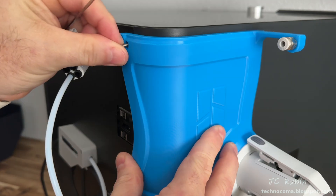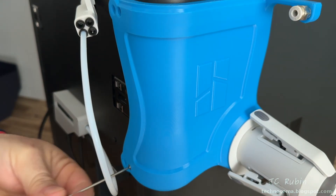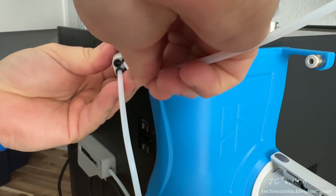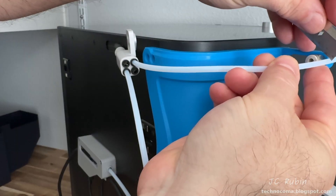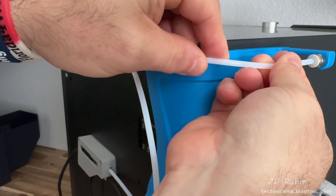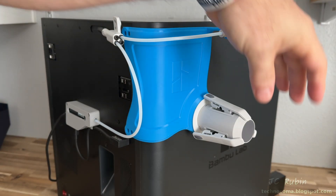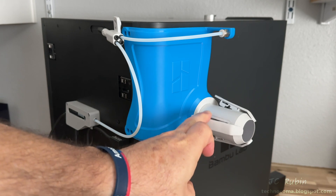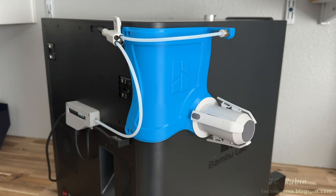With the M3×16 screws — recommended by the designer of the print — we can install our part, and they fit correctly. I have extra PTFE tube: I plug one end into an available port, measure the other side to size, score it with a razor, and plug it into the fitting. The 4-in-1 is hanging for now though there is a print to mount it. We can see there is a gentle amount of back pressure on the spool. One last inspection — everything is looking good.